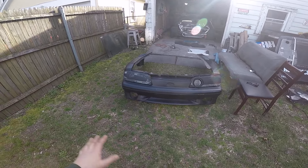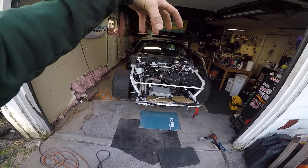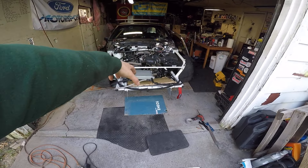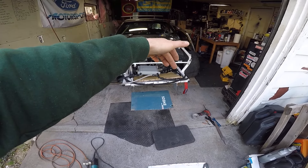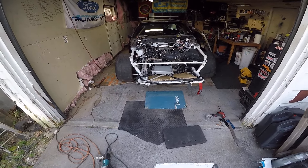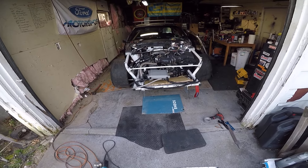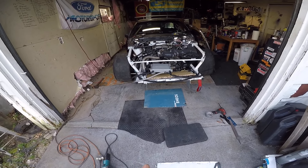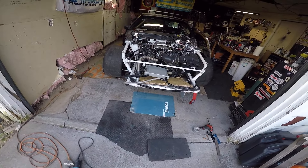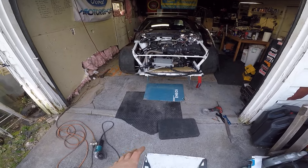On a street car, everyone with cooling fans has big shrouds. Shrouds are great for a street car because when you mount a fan with a shroud, the shroud seals the back of the radiator and when the fan turns on, it pulls all of the hot air from the entire radiator, decreasing your water temp. However, shrouds cause restriction at high speeds. I've seen people put flap doors on shrouds, and I've seen people port hole saws in shrouds. I actually ran no shroud for the longest time, with an electric fan mounted to the radiator — I've run it in push style and pull style, and I noticed it runs better as a pusher.